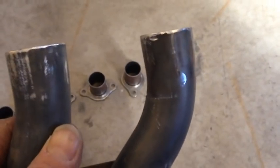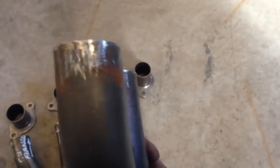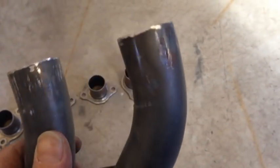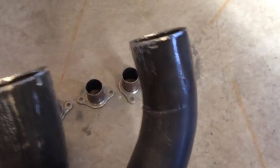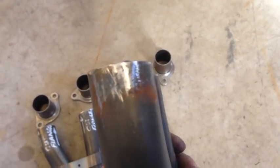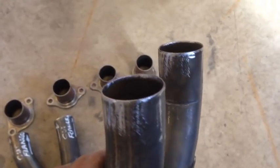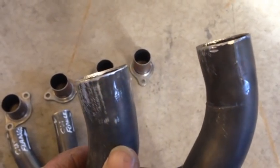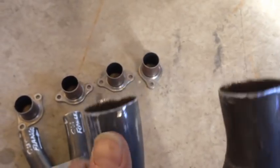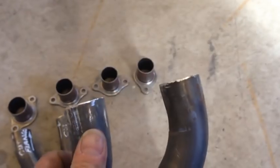Now, Apex guys, anybody with a 4-cylinder, this bend is your nightmare. It is a challenge to get in, and like I said, fit everything on the bench. Now you've got to cut your 4 notches into these so you can get your clamps to clamp down on them. They're solely just to give that clamp a little bit of clamping pressure to go onto the pipe inside. So we'll go to that next.